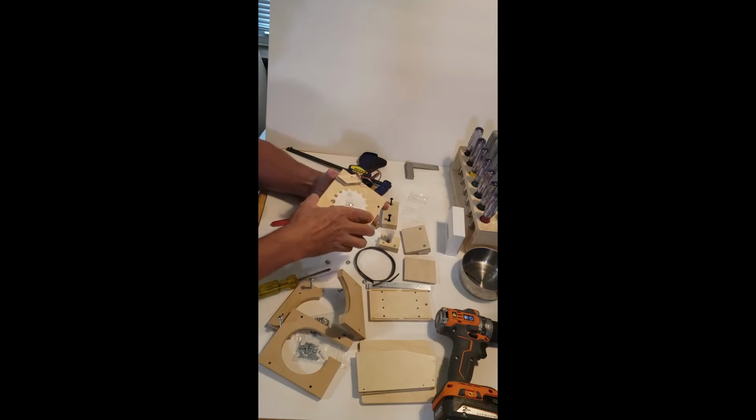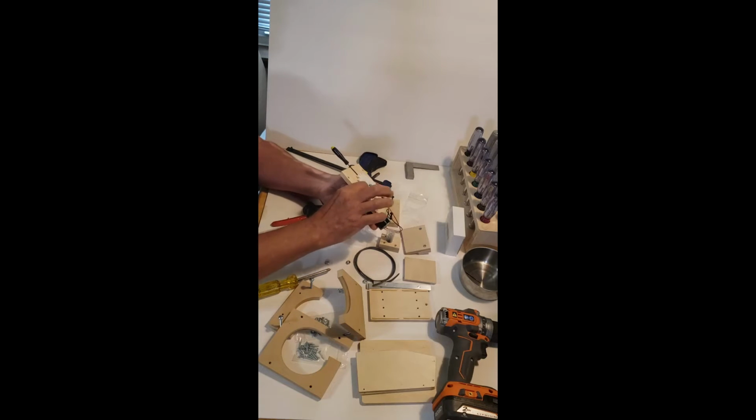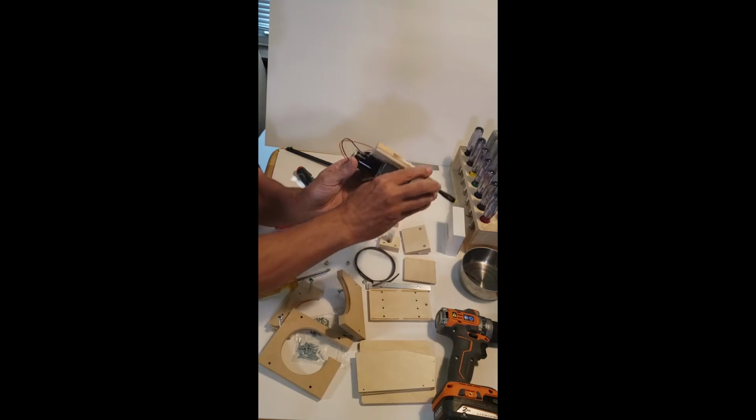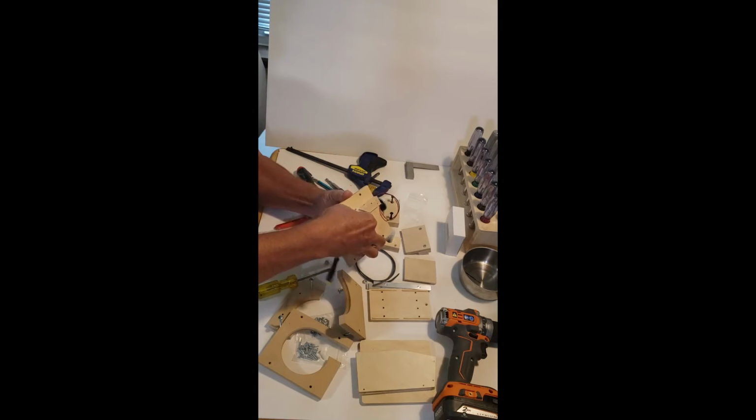Now here's the thing that you have to align and you want to take notice of. And that is the diverter. Now initially in the instructions, I said to put this to the top of the shaft. But what happened is this material is changing over time as I'm buying it. This 3/8 plywood, it's not really 3/8. So it needs to come down. I'm exposing quite a bit of this shaft in order to get the gear in the center of the diverter, which is more important. You don't want that thing rubbing against anything. So I think it's going to be right about here.